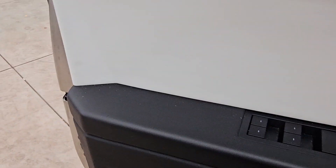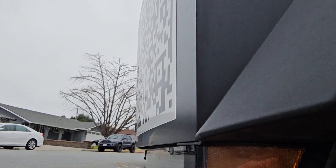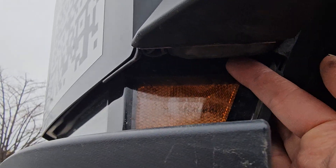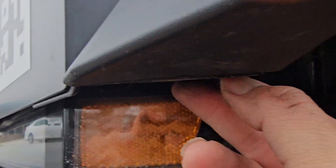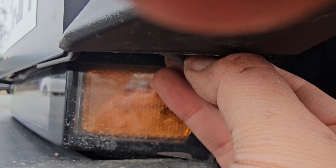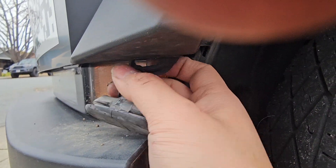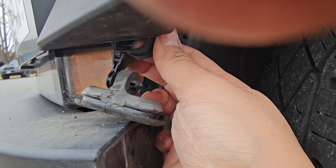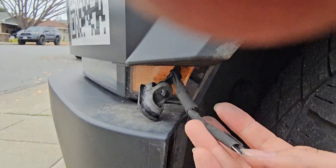So you just go outside of the driver door, and in here you'll see — it's a little bit hard to see — but there's this rubber cover thing right here. You need to get your fingers in there. I'm getting part of it down with my thumb. Basically you pull this in towards the center and down, just like that. You can also go from the back side too. Now you get this whole thing pulled down and you'll want to figure out which side to pull — this side has slack, so you pull on this. Now we have access to these wires.